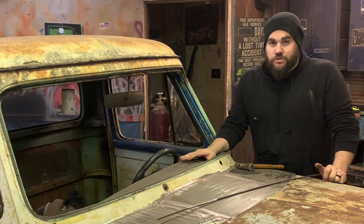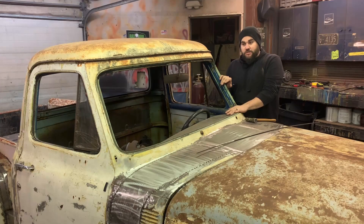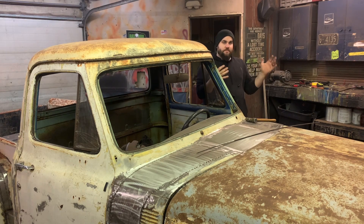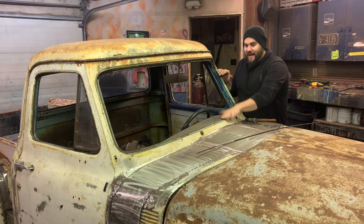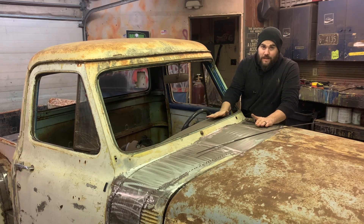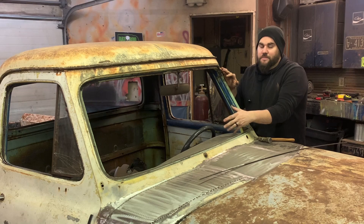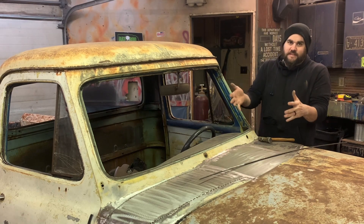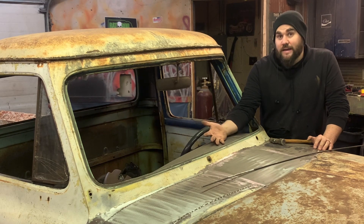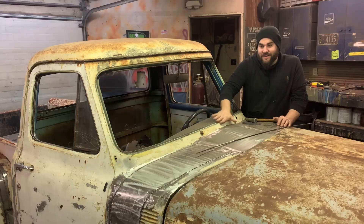But one thing I do want to do is make this Lincoln dash look like it fits this truck a little bit more. It actually doesn't look bad from the sides or the front because of the way the truck comes together — it looks okay. But at the top it looks real bad because you have the top of the cab, and where this dash would normally be way up on the Lincoln, it's a lot lower. So what I want to do is combine these two to look a little bit better. This dash is plastic so there's not much I can do to add to it. What I can do is put a piece of metal over the top of it, basically molding the dash into the cab a little bit better. Not only will it look better, it'll actually be a little bit stronger for my windshield area because I've got nothing behind it currently.